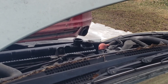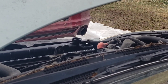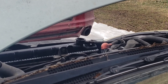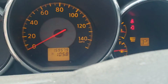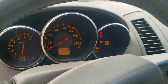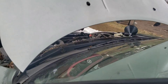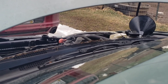There are some bubbles coming out. Revving it up makes your water pump spin faster, so it'll help push some of that out. Make sure you're watching your temp gauge the whole time — make sure it doesn't get too hot, if it does, shut it off. I'm actually going to shut it off here real quick, even though it's not that hot, and see if anything else comes out. It's kind of hard to see on camera if it does. If you were over there you might have seen some bubbles come out. Just wait like 10 seconds, then start it back up.